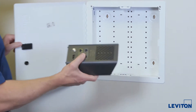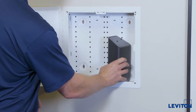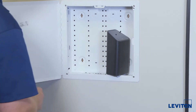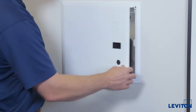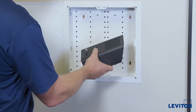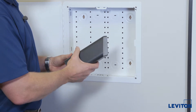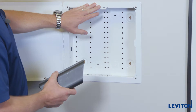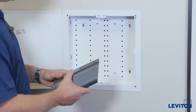These routers are quite large, and when you put it inside the enclosure — even without the shelf in yet — it's too big and the enclosure won't close. This has been a problem with these large routers. We're going to solve that, along with the RF problem and some cooling problems, because this runs quite hot, by changing the metal door that's currently here out to a trim ring and plastic door.